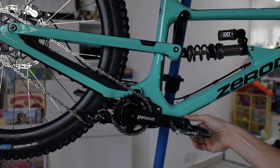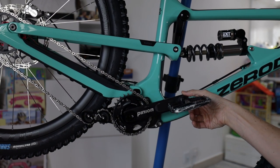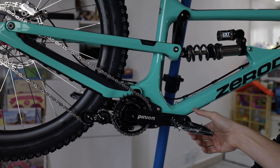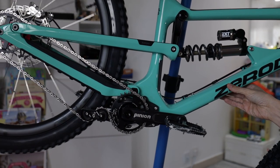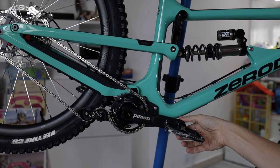Now, this is a disadvantage because when you re-engage the gearbox, the pedals will actually turn quite a few degrees before they re-engage. That said, the gearbox picks up where you left off. So if you don't backpedal, the gearbox takes off where it lets off. So it's actually instant. It's only when you come around a berm and you drop that inside foot backwards that you will need to re-engage it.